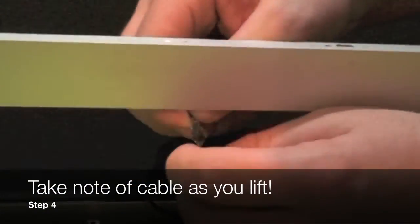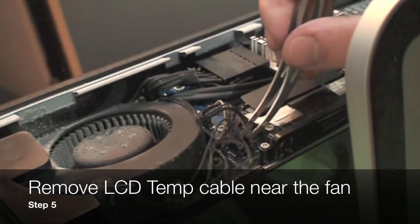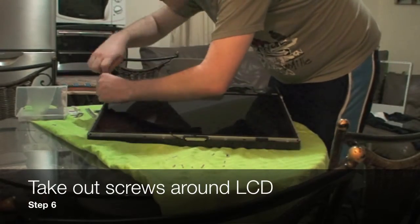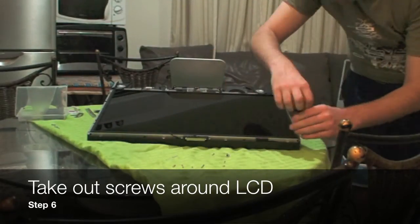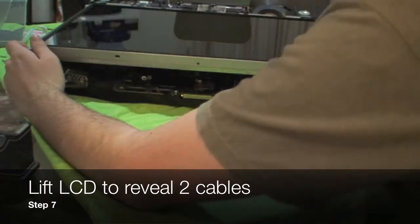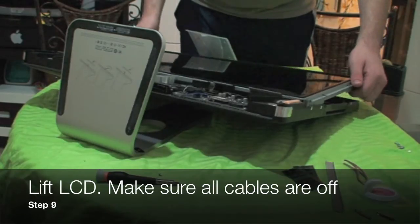There may be tape on that cable that you're going to need to take off. Once you're inside there, you want to go next to the fan where there's a cable that monitors the temperature of the LCD that you're going to want to remove. Just pull that out really carefully, making sure you don't break that in the process. And then you'll be able to remove the screws that are around the LCD screen. Just don't go too fast — take it easy. Then go ahead and pull up the screen a little bit, but don't pull it up too hard because there are some cables beneath it. Take the time to remove those and then you'll be able to lift the LCD clean out.